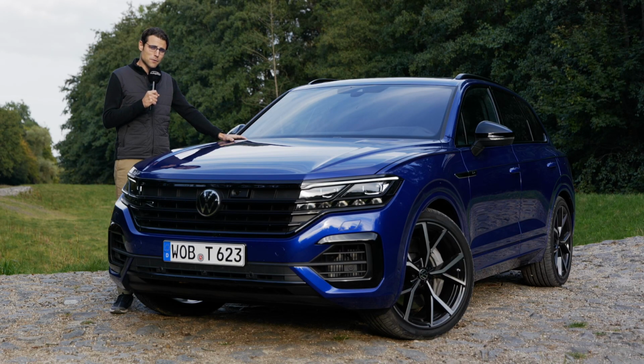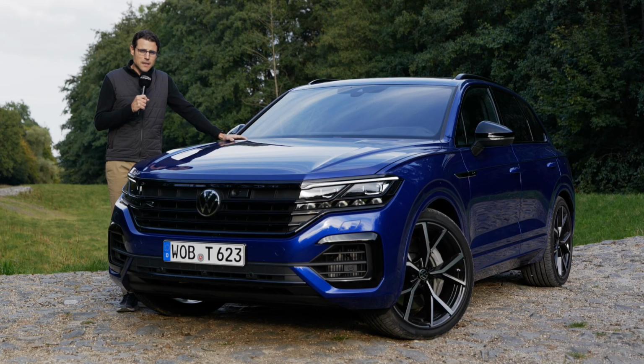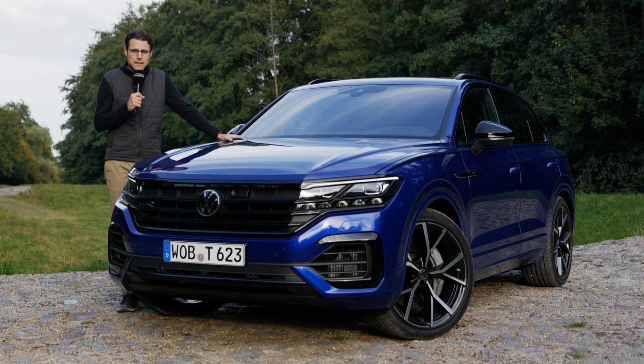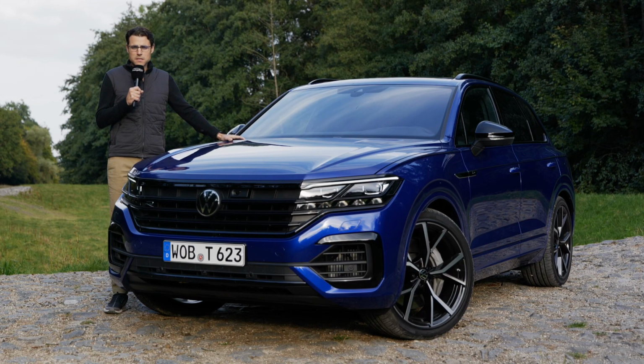And by the way, fuel economy wise, yeah, that's also a thing. So we did a longer run here with some electric driving, but also a lot of motorway. And then we almost ended up with the same consumption as the normal ICE. So that's in about 10 liters per 100 kilometers, some 20 mpg US, 25 mpg UK. There the electric drivetrain does not help so much.